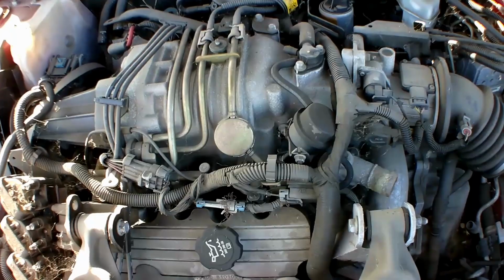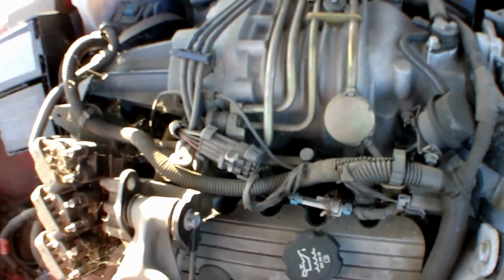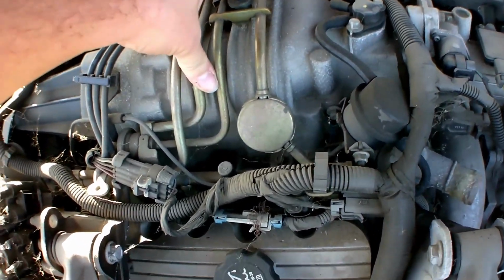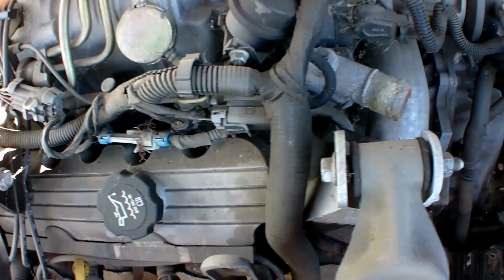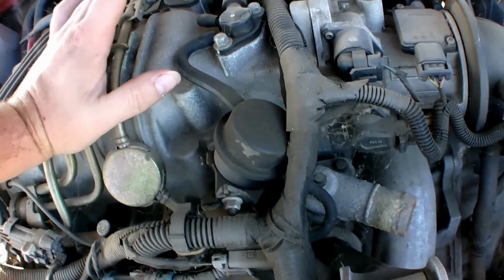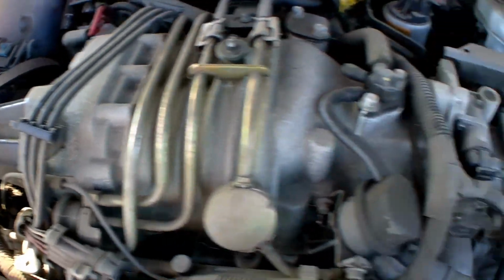Let's take a walk outside. This is also a different generation of the M90 that we used, but this is on an SS Monte Carlo, like you see. So up here is the cone, the important part that goes to the engine, gears that go to the turbines or the fins inside. So up here is all important. So bearing, and then right down, like you see, has this long tail and all the air, all the small control stuff, PCV valves, everything. So we don't need any of that. So we cut all that off and go back inside. But pretty much that's still the fully connected, unmodified version.